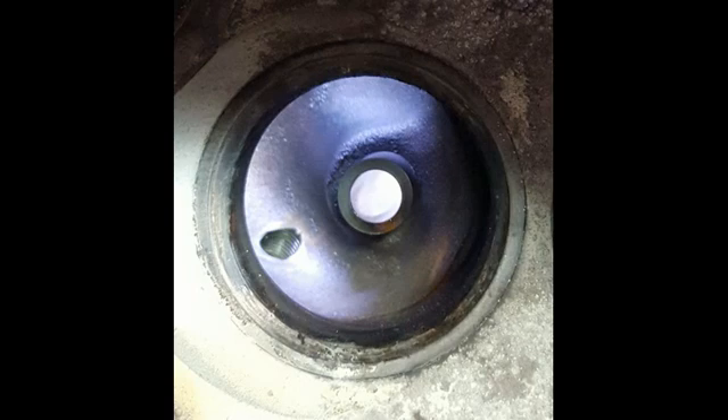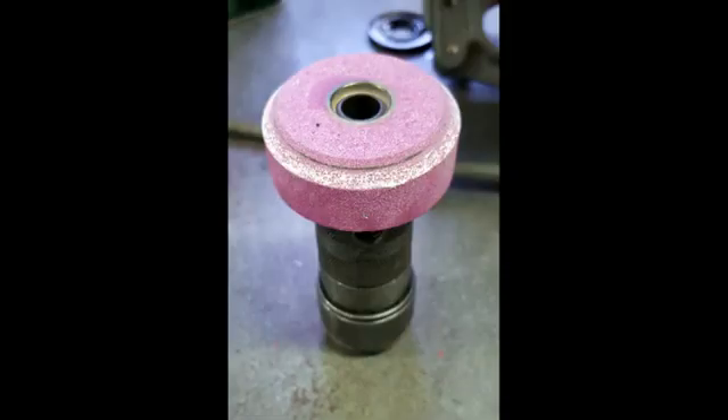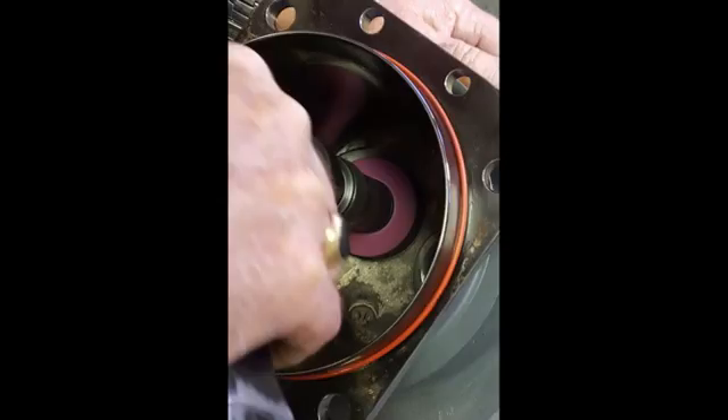You can see here also in the centre of the valve area the round hole where the shaft of the valve goes up, and to which the spring will attach later. Here we have the grinding stone that we're going to begin using on the cylinder to get the seat ready for the valve. The next picture shows that stone inside the cylinder, positioned in readiness for the drill to be attached. Then the drill is attached and we start work on the cylinder getting it ready.